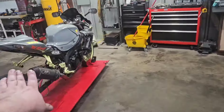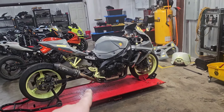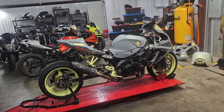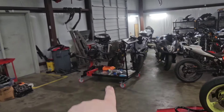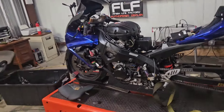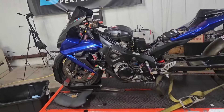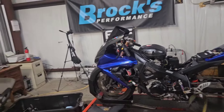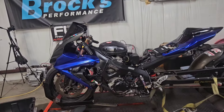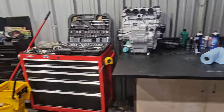Tomorrow I'm going to come in - this one's gotten heat cycled out, this one is done with break-in. So tomorrow I'm going to change the oil in this one. Hopefully I get a call that the air filter came in and I can put an air filter in it and send it home. I'm going to degree the cams I put in that and see if that solves the issue. I just got to run two wires to the toggle switch for the two-step on/off. And put the side fairing on - I think he's got the side fairing that's missing - air the tire down, set the clutch back up, and that thing's ready to go. I need to clean this table off tomorrow too.